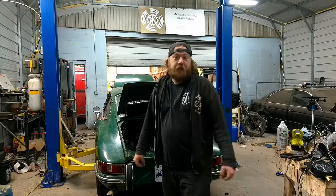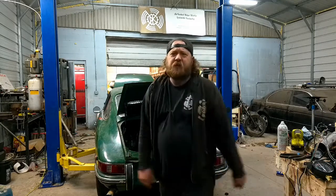so it could be accurate. But anywho, also have been fighting with tuning on this car. In combination between it being a worn out engine, it does pull good compression in all cylinders. I mean, actually even. But couldn't figure out what was going on with the tuning. I mean, I have different jets in it now, so idle circuit was super rich. Couldn't get it to lean out. I guess what I'm getting at.